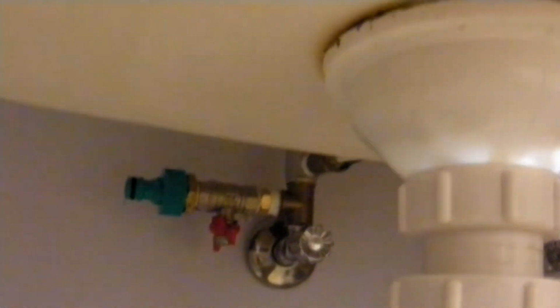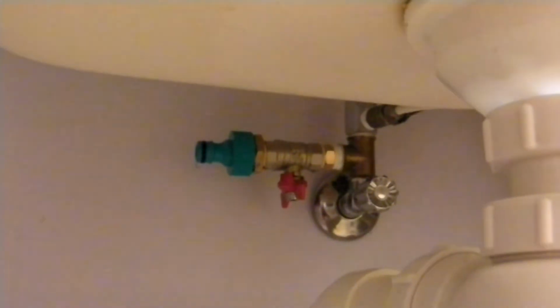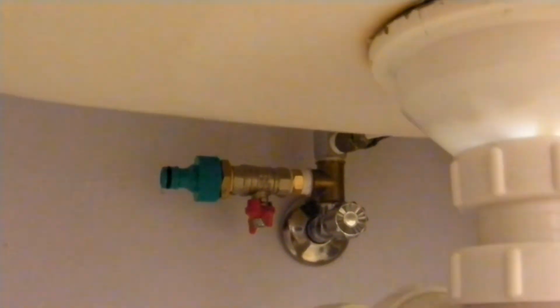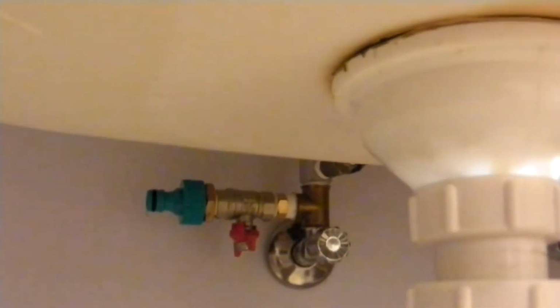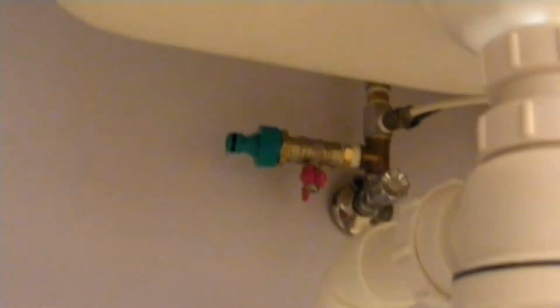The other thing is I noticed that this little stack here has an incredibly slow but persistent drip. Means I have to take it off and redo it. The vertical stack is okay, the horizontal stack not okay. So I'm going to try and get that horizontal stack out, retaped, and insert it back into the vertical without messing up the seal and the vertical stack. Wish me luck.